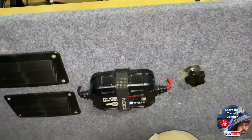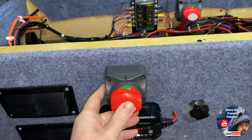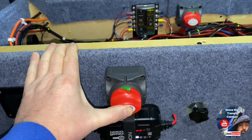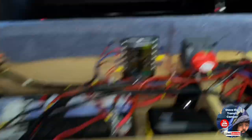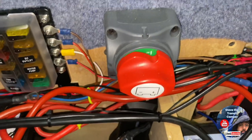This is a switch I'm going to make accessible from the outside, so I'm gonna put it on the outside of my panel — what I call the heart of the beast, where all my wiring is amassed. I'm gonna put it just above the battery charger. I'm gonna mount it there, and when I get in the van it'll remind me and be easy to access — I don't have to take the seat off every time to get to the isolator. It's the same switch as the one I've got for my battery there, which looking at it now I fit upside down — but that doesn't matter.